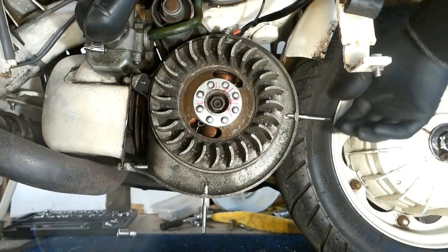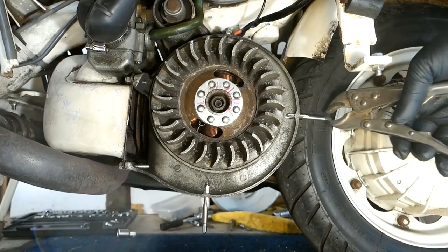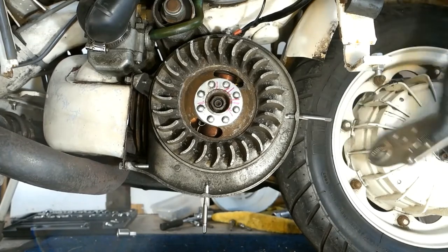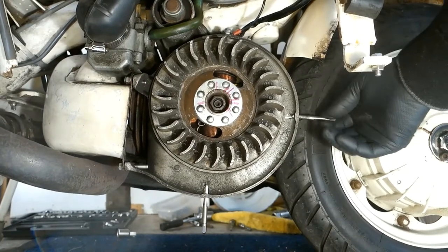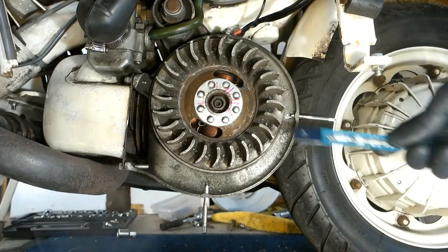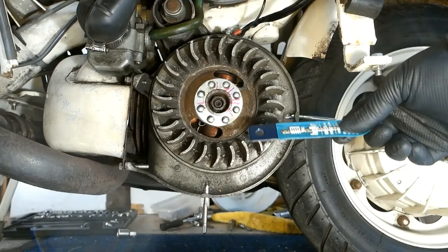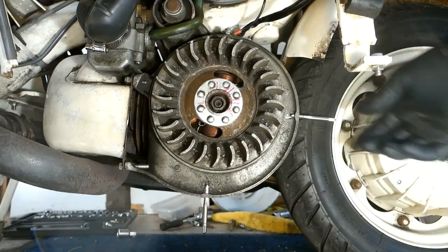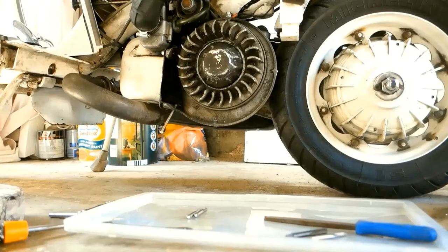This one, this one also — I found the tap wrench didn't really want to go in straight here, so I just used vice grips to turn it. It's soft metal so it's not difficult. The sheared bolt in this hole was actually stainless. So I bought some 2-pack cobalt drills from Tool Station and drilled it out at a slow speed. Filed it flat, gave it a centre punch and had a go drilling it. The problem is drills don't want to go in straight.